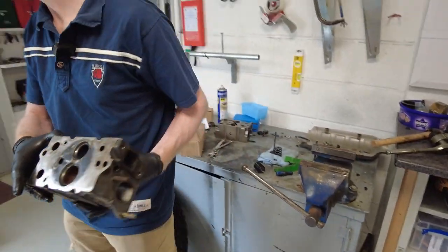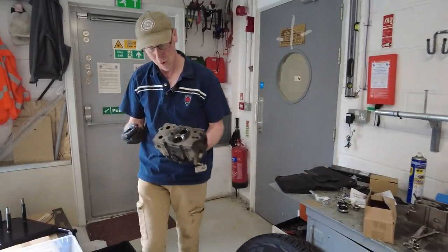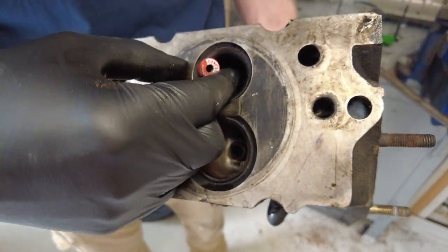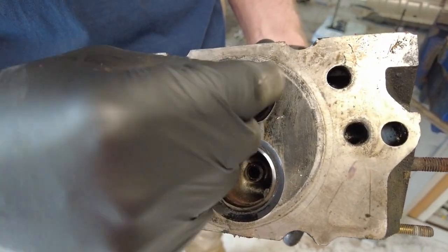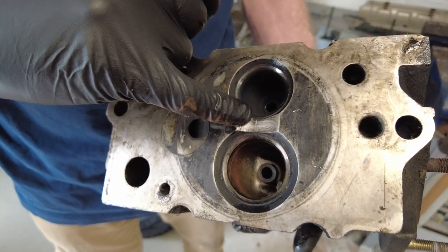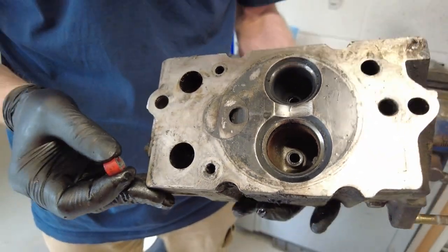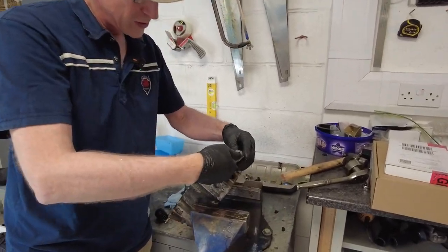The cylinder head is aluminium and you can see it's non-magnetic. But these valve seat inserts are actually hardened steel that's inserted in — you can see all that edge. I think that's why these are okay: the hardened inserts form a seal, and I don't think the cracks are as serious as they would be in a normal cylinder head.